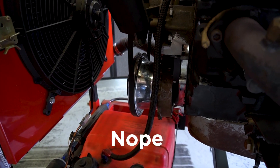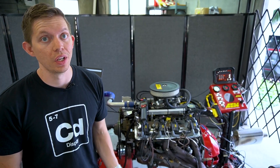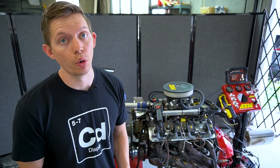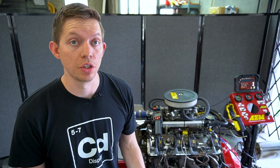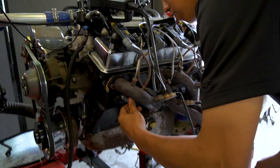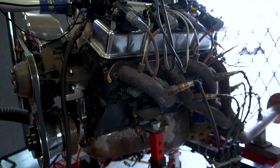We checked the timing on the engine for the first time while not running and our timing light wasn't firing. What we're going to do is pull that plug out and open up the gap a little to get a better reading on our timing light. Another tip when syncing ignition timing is to pull the plugs out of the engine entirely — this reduces overall compression, allows the engine to crank over faster, and avoids depleting your battery during the ignition timing sync process.